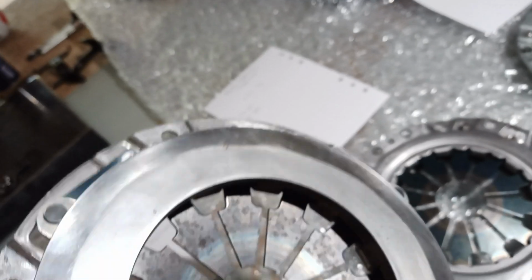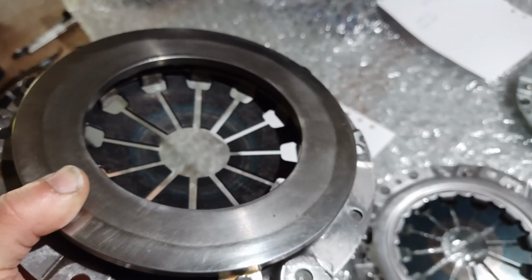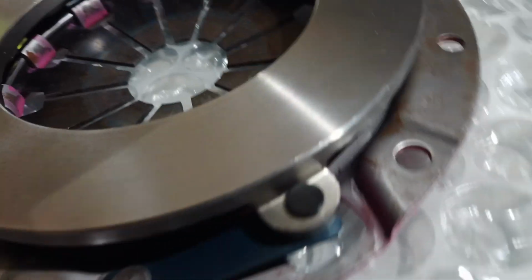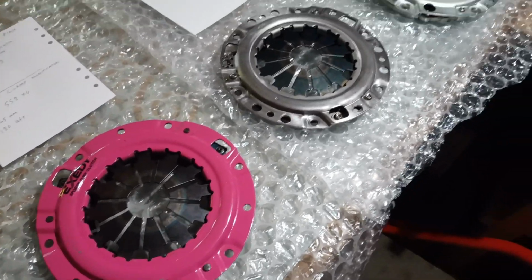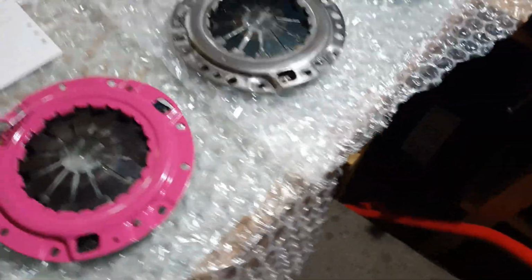So on this one, which is also this old new one that I've been playing around with, I'd actually started to rub it on my surface plate there to get it nice and flat. You can see the edges. The more I do, the more it works its way inwards to making it nice and flat. Takes a long time by hand, but I don't know why that occurs with this modification. It's obviously to do with the way this ring is resting. Really, you do want a nice flat surface, of course. Once the clutch is bedded in, then the friction material is going to take shape anyway. But it's certainly nice to start with something that should be flat.